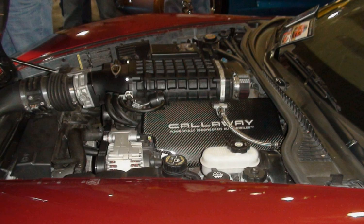The 4.06 in bore block family was designed as a replacement for the LS2 but enlarged to better accommodate variable valve timing and active fuel management while still generating good performance. This family of engines has mainly seen duty in performance cars and high-end SUVs. The 2007 Cadillac Escalade has a 6,162 cc Vortec 6200 HPO L92 engine. It is an all-aluminum design which, while still a pushrod engine, boasts variable valve timing. The system adjusts both intake and exhaust timing between two settings.